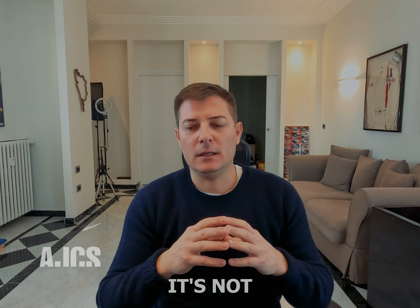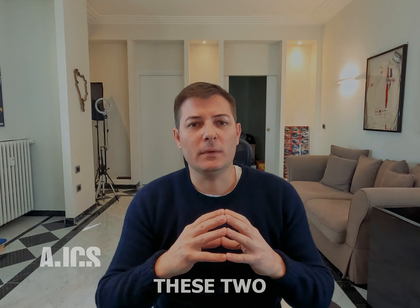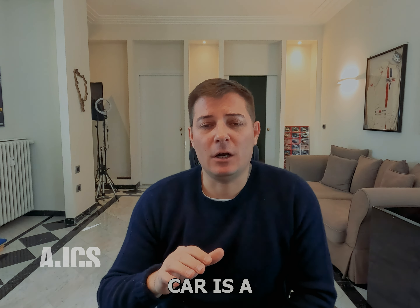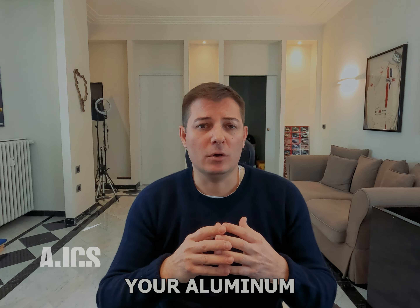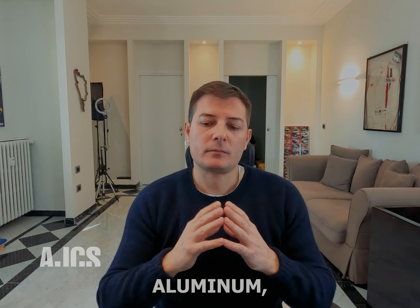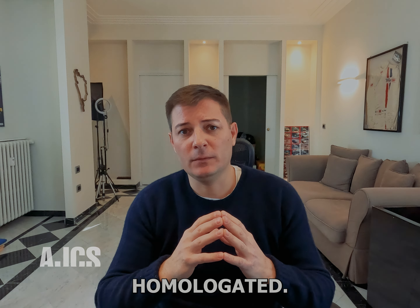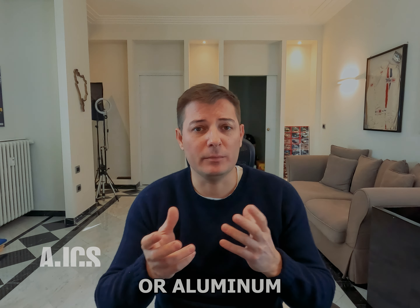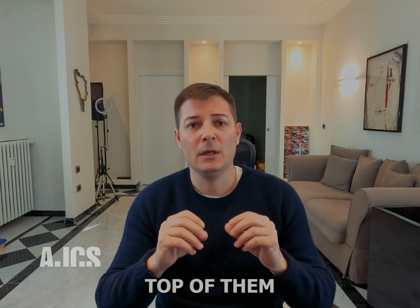It's not so easy to understand, but in fact the way these two materials work is very different. As long as this car is a road car, you will want to retain your aluminium bonnet, because aluminium — for the way it distorts — has been specifically designed and homologated for this car. The same applies to rally cars, where you have to maintain the steel or aluminium bonnet, and then place the vents on top, because of road-going compliance.